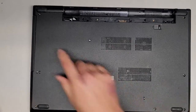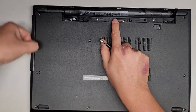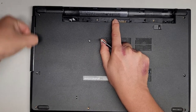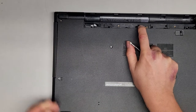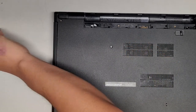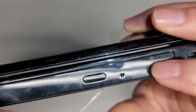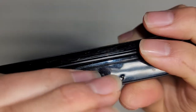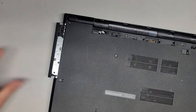All the screws are removed. Now we're going to remove the CD drive — I usually just use my fingernail and wiggle it out. If it doesn't come out, you can get a needle or a bent-out small paper clip. On the side there's a little hole; you can get the needle into that hole and wiggle it around, and it'll pop the CD or optical drive out.